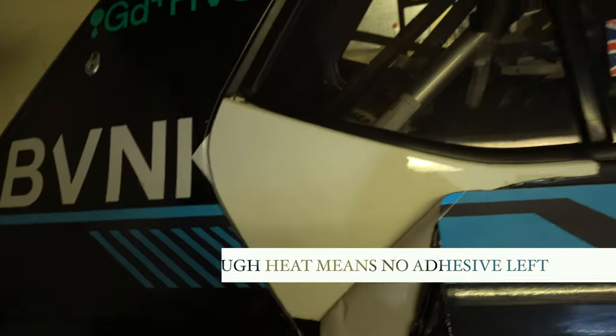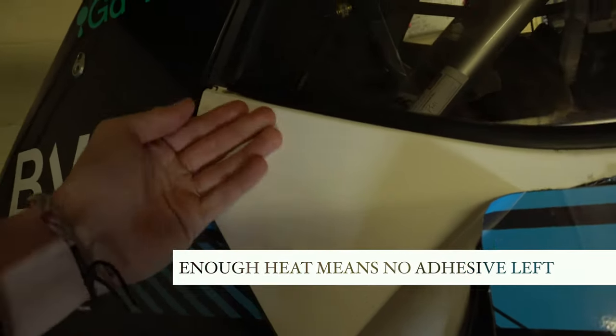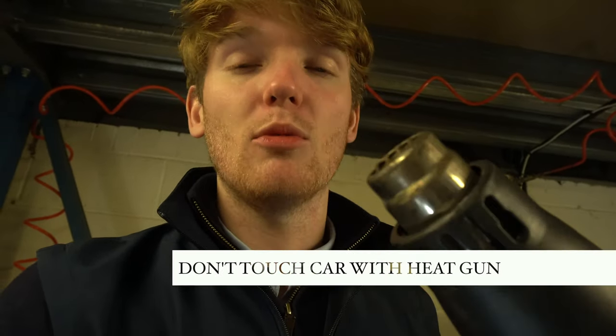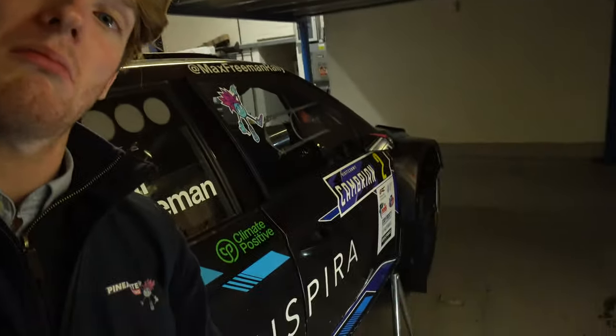As you can see there is no glue, nothing left behind at all — it has come off perfectly, exactly like we wanted. Although it might sound obvious, don't keep your hand too close to the vinyl and too close to the heat, and be careful of the top of the gun itself because it gets very very hot and it's easy to burn yourself. I'm now going to speed up the process, get more of this side done, and show you how it develops as we go across the whole car.